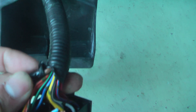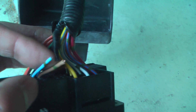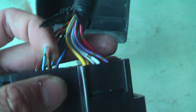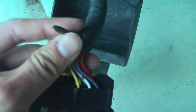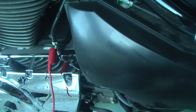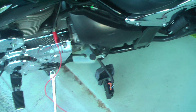I've already soldered them together, and with a bit of electrical tape — because these two wires have no power in them, you can leave it like that, or just put some tape onto the wires. If you want to bypass the relay for the indicators, you need to cut these two wires and bridge them together — just rejoin them together. Once you finish that, you turn your indicators or your hazard light on, and that will give the indicators continuous power output instead of the interval power output.